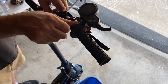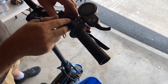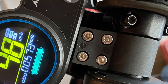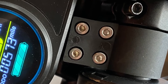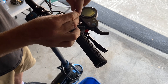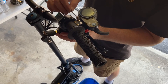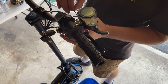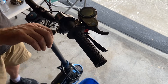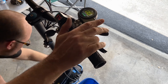When you tighten these displays you'll notice there are four screws on the display — whether it's the QS-S4, the Mini Motors i-display, a Dualtron, or a Kaabo. Two of them hold the display on; the two closest to the display, don't touch those. The two that keep it tight on your handlebars — since those mounts are usually plastic you just don't want to over-tighten them, so use your allen wrench in the long position so you don't get a lot of torque on it.